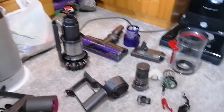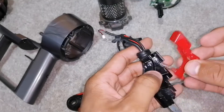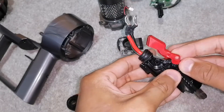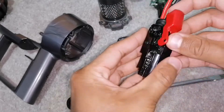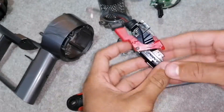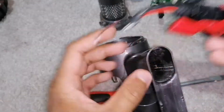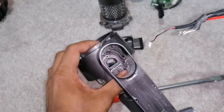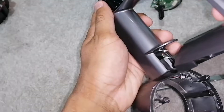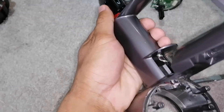I've pretty much stripped down the entire unit apart from the cyclone. Now it's time to reassemble the vacuum. Put the spring on the pointy part and then clip the trigger on. Slide in your trigger assembly, making sure these wires go through that hole and come out of here. See how these wires want to come out where the trigger should be — push those in with a screwdriver.